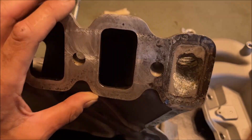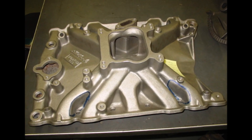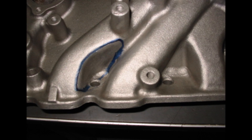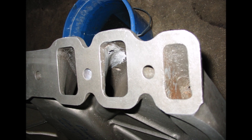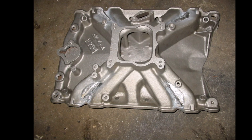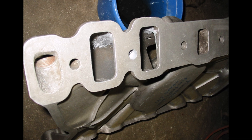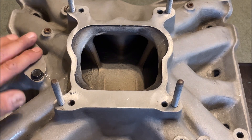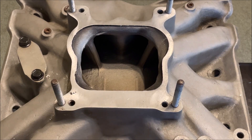I'm going to show pictures of what I did on a previous Torquer intake on my last engine. I took it to a welding shop and they filled in this entire area, including covering the bolt holes. You've got a bolt hole on either side of the pair of runners — I don't think that bolt hole is necessary. They TIG welded over the bolt hole and that entire area, filled it, and I was able to port and grind that out. The Torquer does also have a provision for the heat tube for the choke, which I don't think anybody using this intake needs, but it is there.